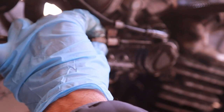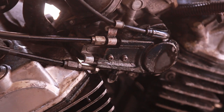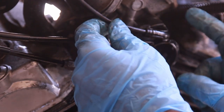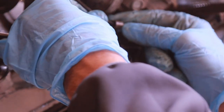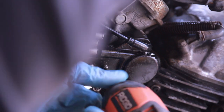I'm not really looking forward to that — it's much more work. My throttle is completely stuck. It could also be that the rubber is stuck on the grip but I'm unable to remove this. This is very familiar from the Kymco. I think this is like the choke — it's an enricher type of choke — so I'm just going to pull this off like this. It sprayed a lot of oil. Yeah, that worked.